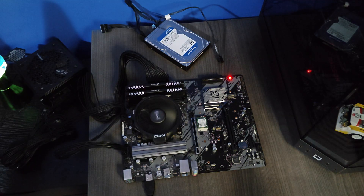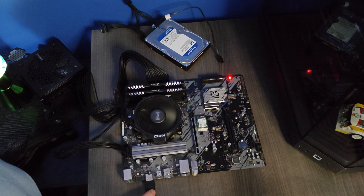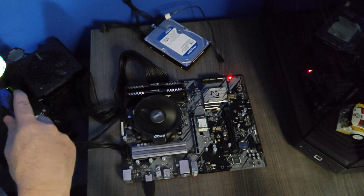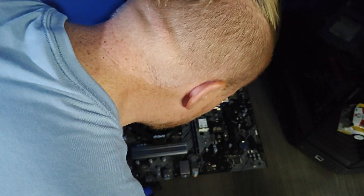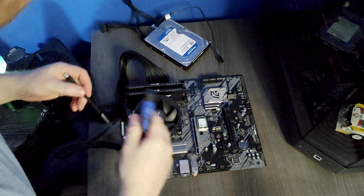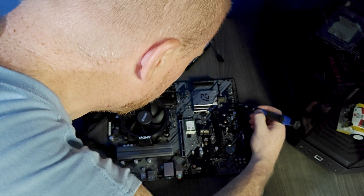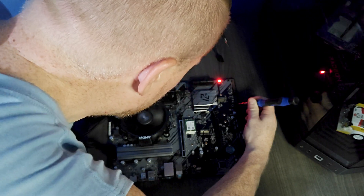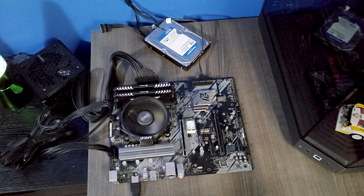I'm using onboard video, but he had a graphics card in here. I wonder if it's defaulting to PCI. So we'll shut this down again and clear the CMOS — I'm sure there's a jumper on here for that, but if not I'll just pull the battery. Power it on for a few seconds. I need to jump power and jump the CMOS. The monitor just woke up, so that's a good sign. It's booting into Windows!